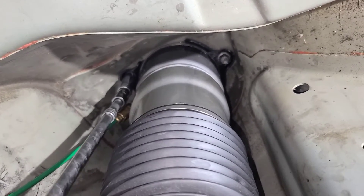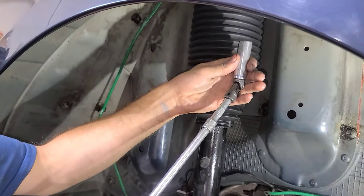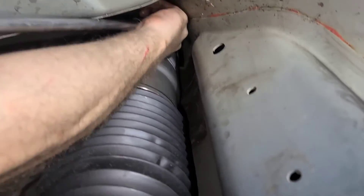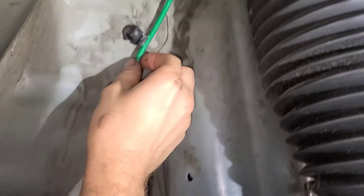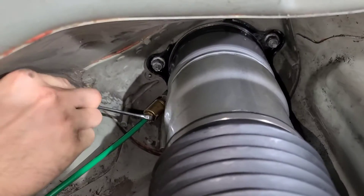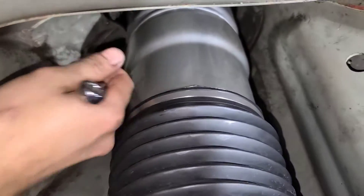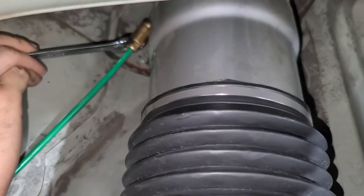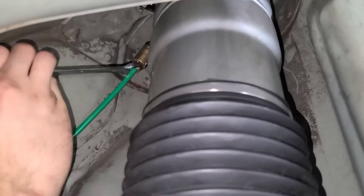Now we're going to clip this line in — I just put my finger and push on it. Then we're going to come up above and snug this line the rest of the way down on those three bolts up above. Make sure to reduce your torque spec 30% — so if it's 40 Newton meters, multiply that by 0.7, and that's going to be your torque spec with anti-seize. Just finish snugging this up; we're not killing it, just until it's nice and snug.